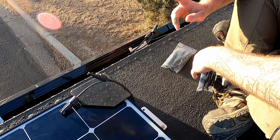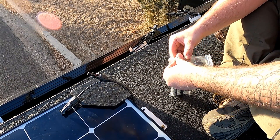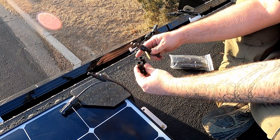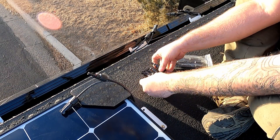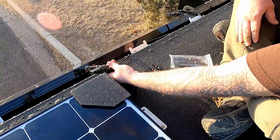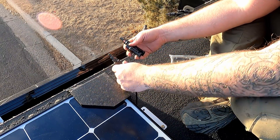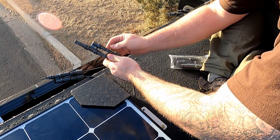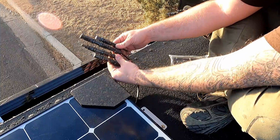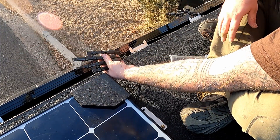I may have gotten really lucky with the placement of this because I was worried I was going to have to make all these extra little wires to be able to connect these. These are the parallel connectors that I got — you can see they take two male and two female connectors and bring them into one. It looks like these might actually reach together so that I can just have a single convenient spot to converge them. Make sure you go until you hear a full click and there's almost no space right in between there — that's what makes the watertight seal.